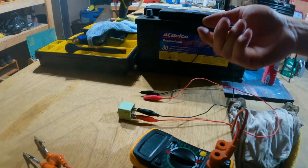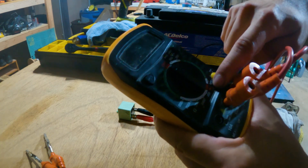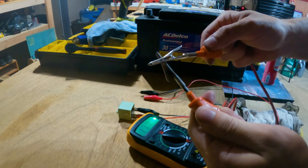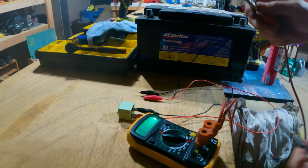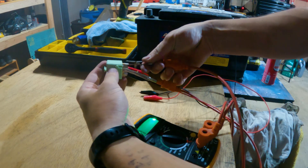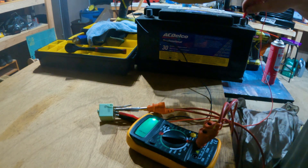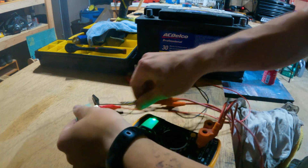This thing is clicking. Now a better way to test it is using a multimeter — there's a little red symbol that looks like a Wi-Fi signal. Basically, when you connect the power, the multimeter will make a tone, which means the connection is working. Connect one probe to pin 30 and the other to 87 — you hear the click and the tone. So this relay is working. I'm not going to replace this.